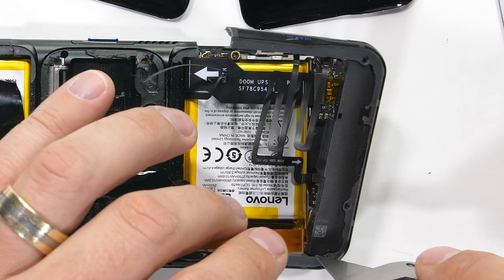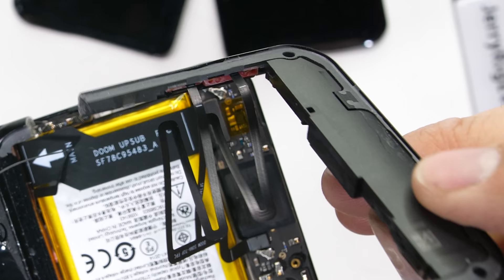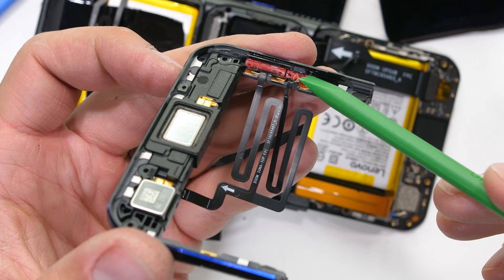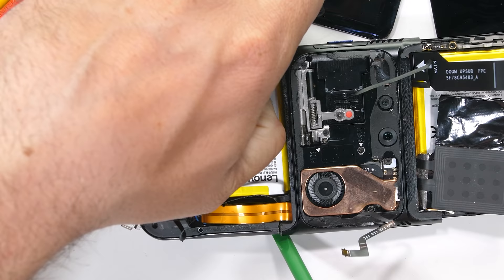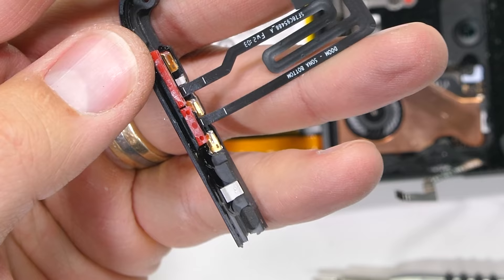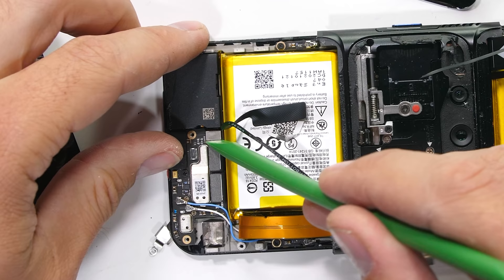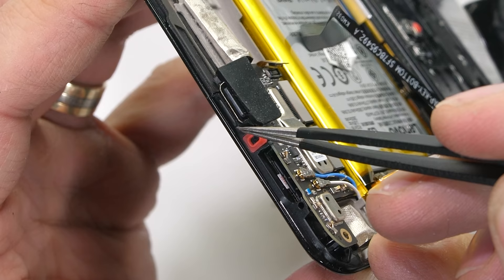The thin slinky-looking ribbon is for the dual ultrasonic triggers in the upper corner – now we've found four of the 8 triggers. The ultrasonic buttons are very much glued into the frame, so this is as close as we can get. Here's the bottom stereo speaker as well as one of the dual haptic vibration motors. This same setup is pretty much mirrored on the other side after removing four more screws and taking off that third of the back housing. We see two more ultrasonic corner triggers – we're now up to six – along with another dual vibration motor. Real video game controllers have multiple vibrators, so it's cool to see a gaming phone do the same. There are also some water protections like a red rubber gasket and mesh for the microphone opening.